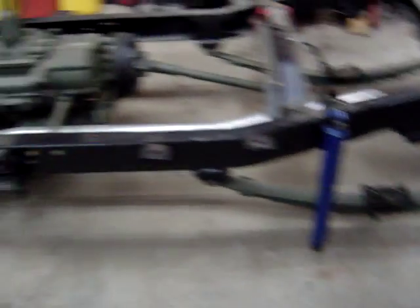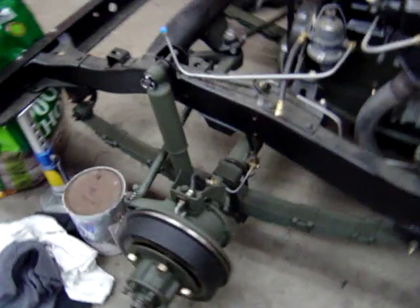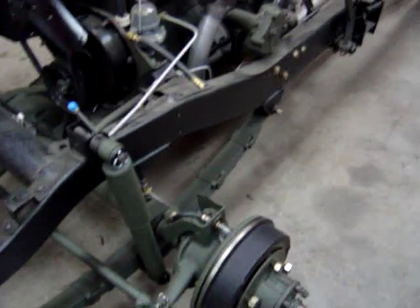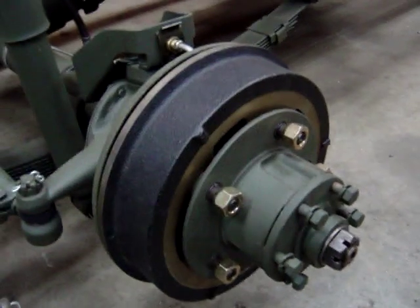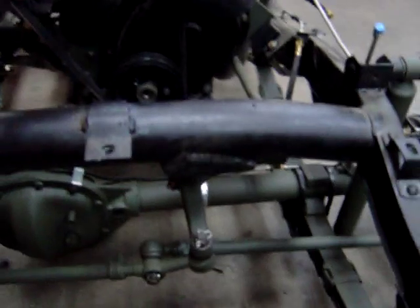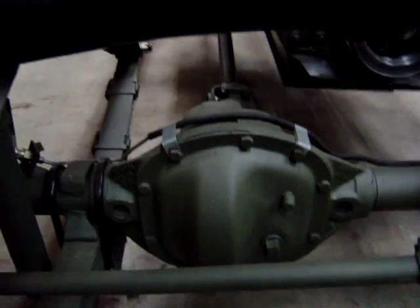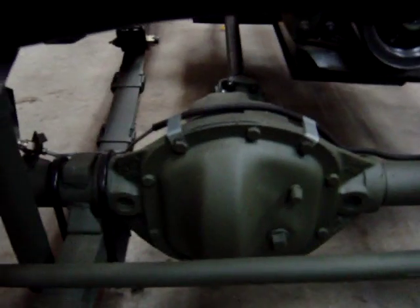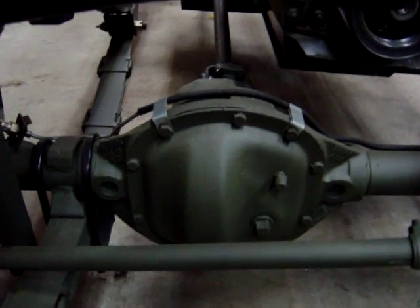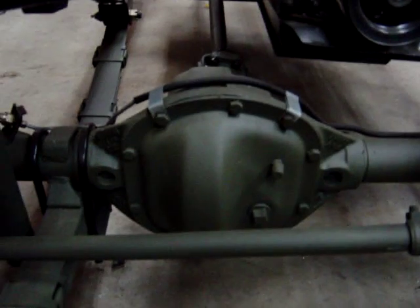I don't know if I had all the springs on there, but they're all rebuilt now. Pretty sure I didn't have the front end on before. You can see here I've got all new bearings and rotors, or drums, so on and so forth. Steering linkages, pitman arms, and bell cranks — the front end was completely rebuilt. Nice bit of trouble, actually, rebuilding the front end. Backlashes and clearances and all that stuff, but I think I pretty well got her good.